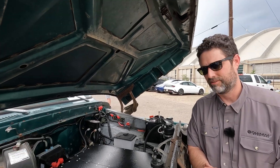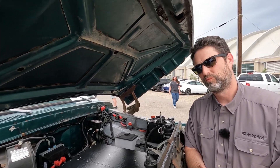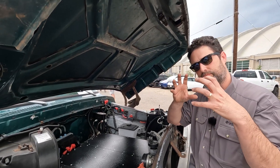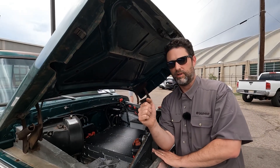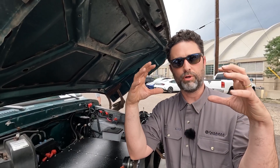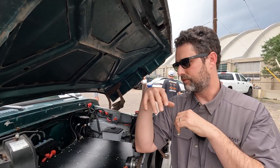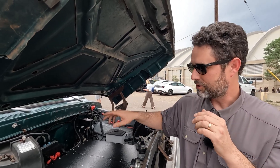We have the 30 kilowatt-hour battery, Thunderstruck BMS, Tesla modules, and the Dana motor. How is that motor putting power to the wheels — are you maintaining the transmission? We're using direct drive — bolted directly to the transfer case. It's still four-wheel drive. You can still select between two-high, four-high, and four-low. The transfer case made for a very nice bolting position and worked quite well. There's a gearing relationship we're still working through between the motor and the transfer case, but we're close on a solution — lessons from the first build.